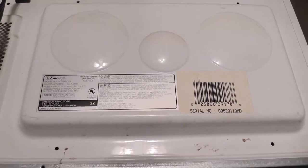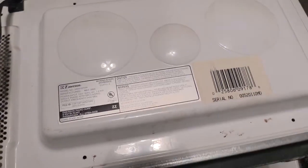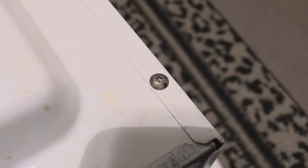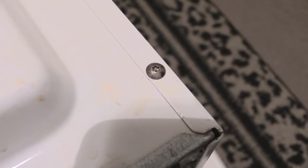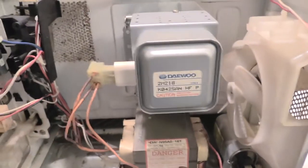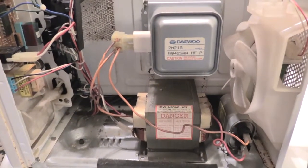The first thing you'll need to do is open up your microwave. I flipped my microwave onto the front, where the face is facing down. If you look, you'll normally have about three screws — here's one right here. These happen to be security screws, so you'll need a security bit. You can get a security bit set pretty cheap from AutoZone or Home Depot. I'm going to go ahead and remove this screw.